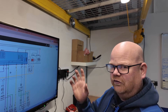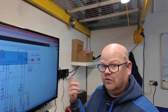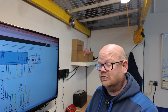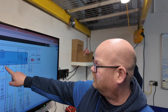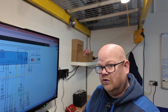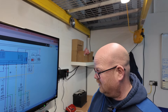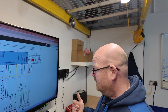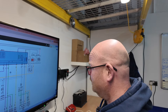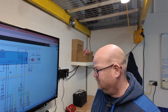One thing I did notice: on the left-hand bulb that had fallen out, that was a bit grubby and I haven't checked we've actually got power going to it. And that plug going into the right-hand side was a bit iffy as well. What I would normally do is go to plug C on the body control and see if we've got output from it. But because we've got possibly two points of failure, we're going to go straight to the back, pull that plug out, put our foot on the brake, and see if we've got power down there. If we have, we know it's just contacts into the back of the lamps.